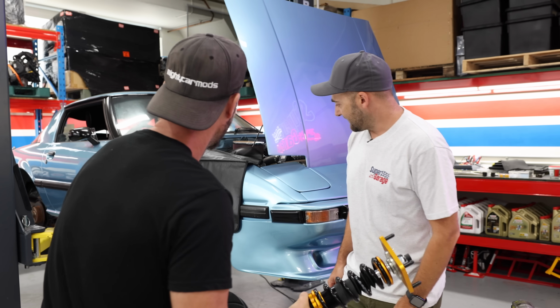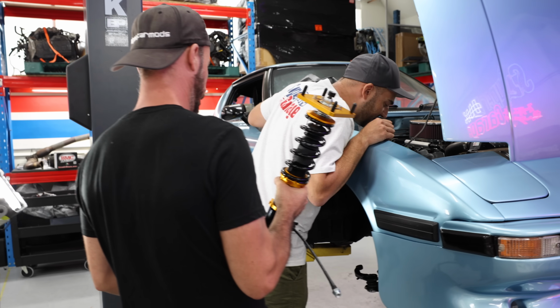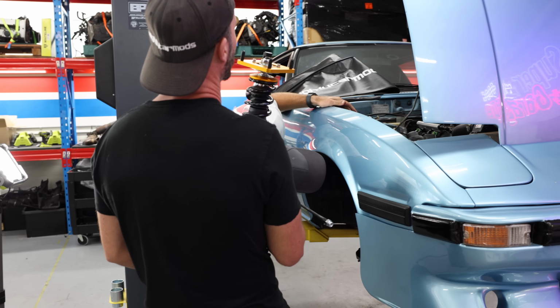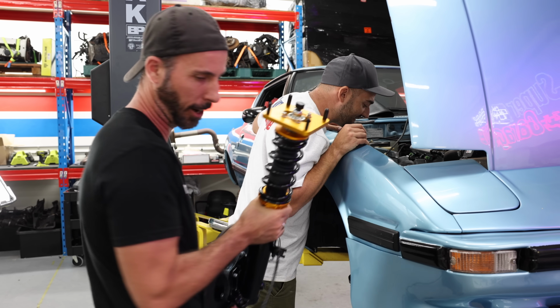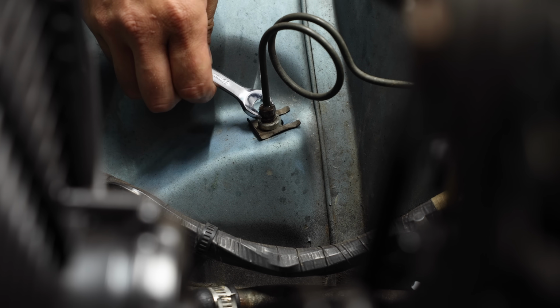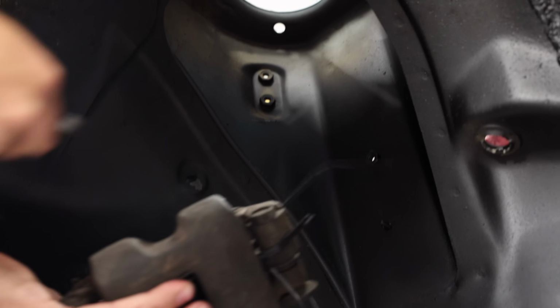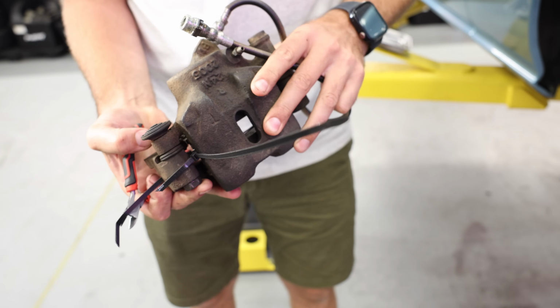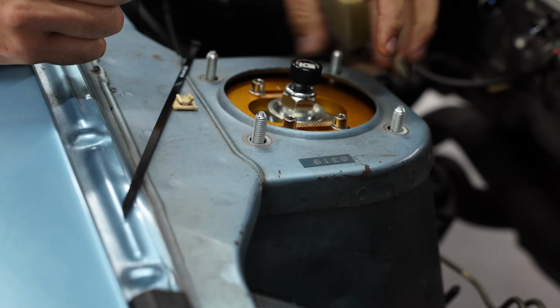It's that simple. But also we have the brake line to worry about as well, which we need to make happen. Looks fancy, man. So we're going to get rid of the brake caliper and then put it in because there's a brake caliper in the way. Great. I'll undo that first. That's right. In order to keep as much air out of the braking system as possible, we have to work quickly. By disconnecting the original brake caliper, then quickly swapping in our new coilover and caliper, we can minimise fluid loss and mess.